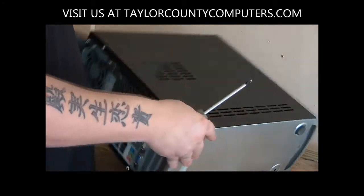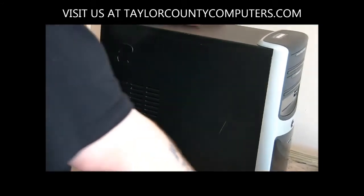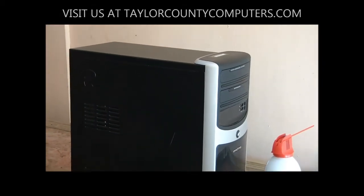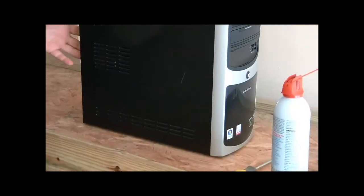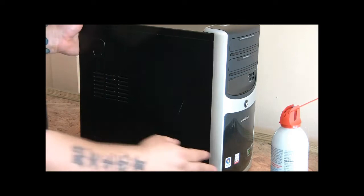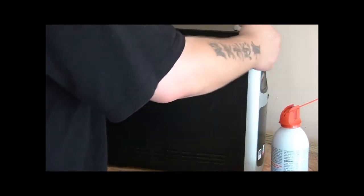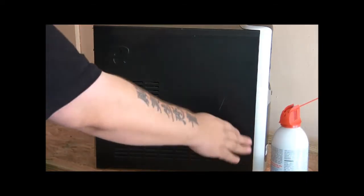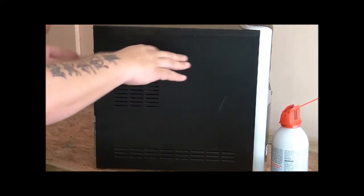One of the points I wanted to make is a lot of people don't understand what they call the technology heat load venting. It's basically how this machine cools itself. It is designed to bring in air from one side and bring it out from another. It may be coming in from this side and vent here, but blowing out the back. So it's all designed to travel through the machine a certain way. That includes traveling across your video card, traveling past your heatsink and fan, and then out the unit.